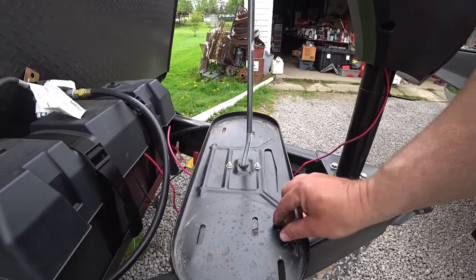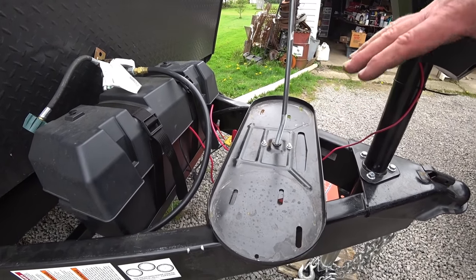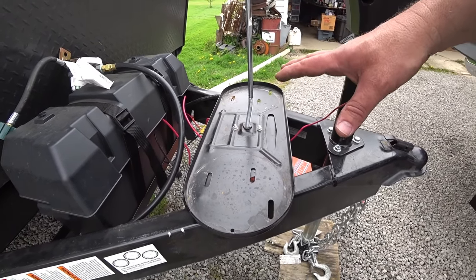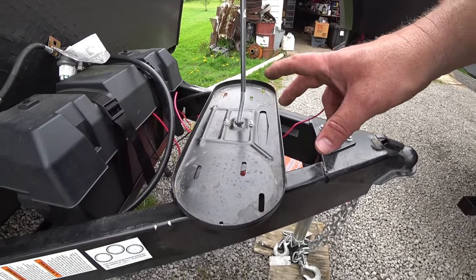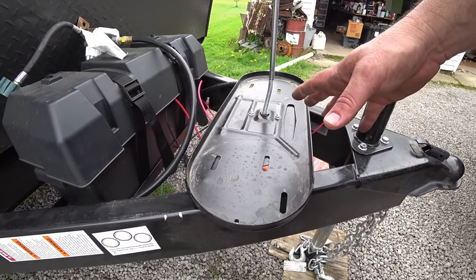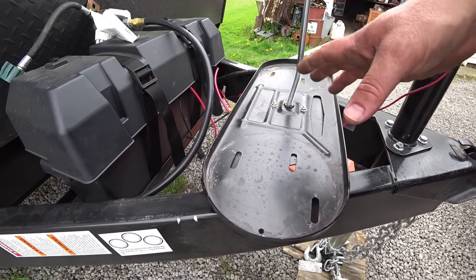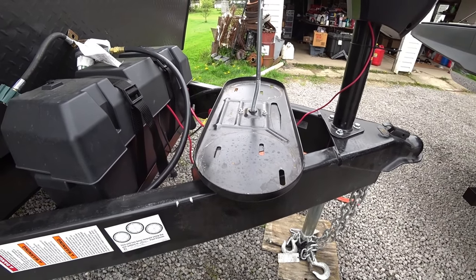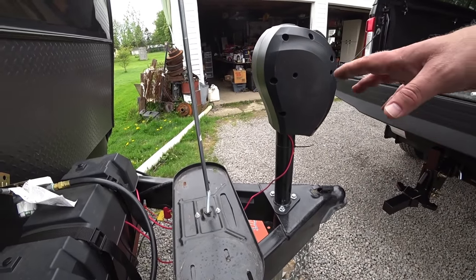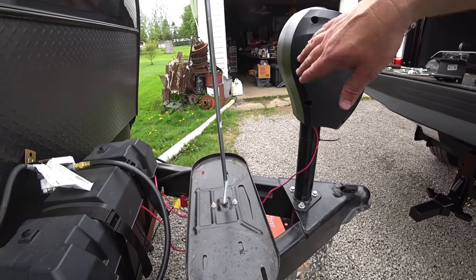For me, I made a simple modification — removing the screws holding down the propane tanks and moving the propane tank base forward. If you have to do any modification to your tank mount, you may need to adjust when you put on the cross bracket that goes underneath the A-frame. So if you've moved the propane tanks loose, just keep them loose because you may need to get back there for more adjustments during mounting. I tested this and I am within one inch — at the 27-inch mark everything mounts fine including the hard propane tank cover. It just pushes up against the back of the jack but it's all plastic and it will flex around it.